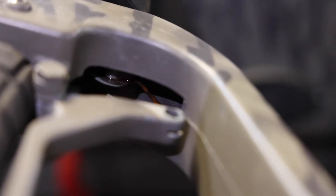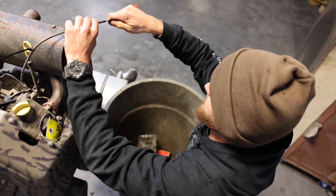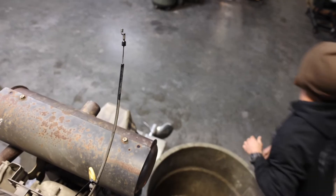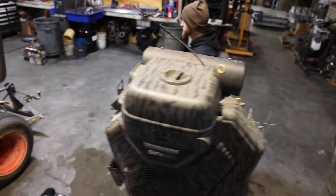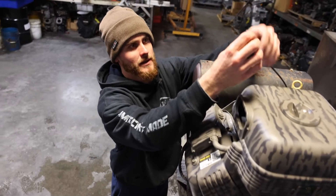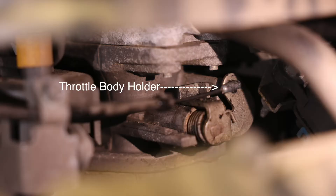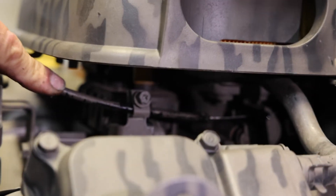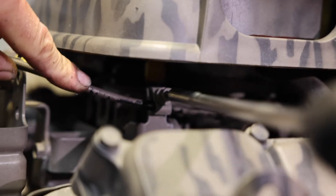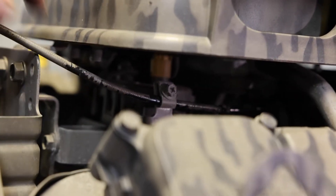It's already starting to come out of the end. Undo the funnel and cut your cable tie. Slide the rubber cap back down to keep any moisture from getting back in it. Then slide the cable back into the throttle body holder and put your cable back in the clamp. We're going to snug it down.